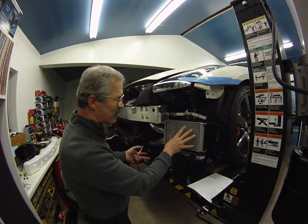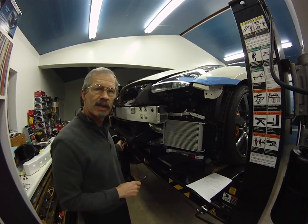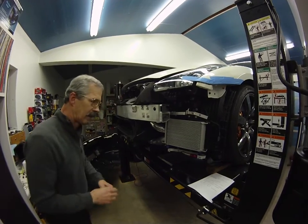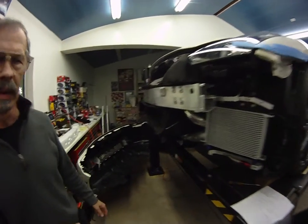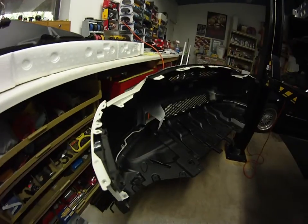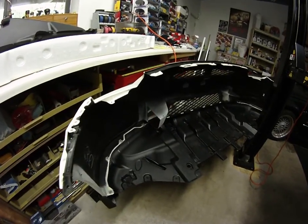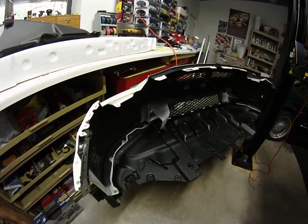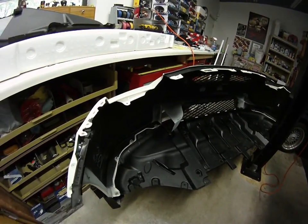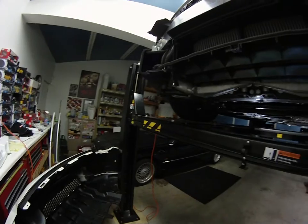Once that was done, we moved to the back. In the nose of the GTR from the factory, this area is blocked off, so it needs to be cut out the same as the side that has the oil cooler, so air can flow into the ductwork. It wasn't too bad an operation. You do have to be careful when cutting through because you don't want to scratch the painted surfaces on the other side of the duct. Maybe put some tape in there to prevent any accidents.